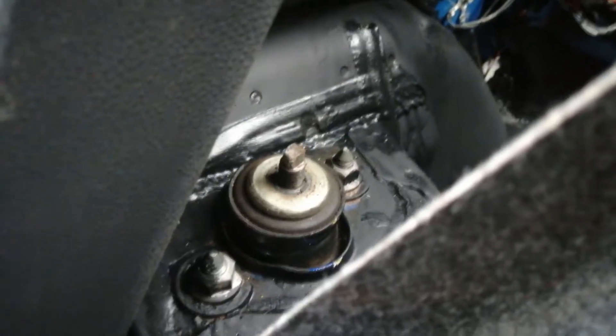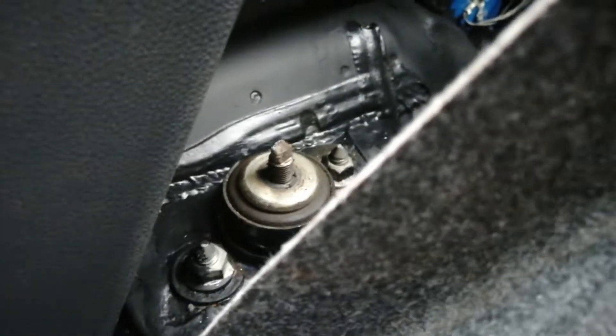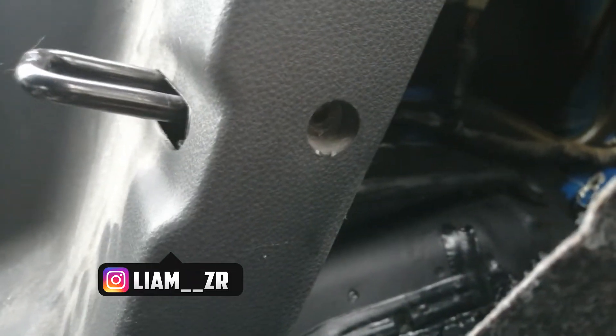The trim piece is out. All I'm going to have to do now is put the strut brace through the gap, line it up with the top of the strut, then put the whole carpet assembly back together where it should be. It has got quite a lot of leeway because obviously that hole is a lot bigger than a screw hole. I'm hoping it goes in alright.